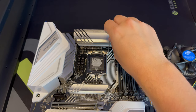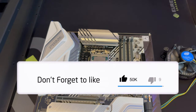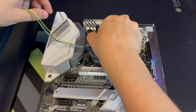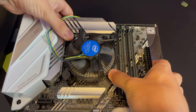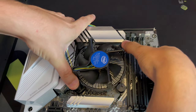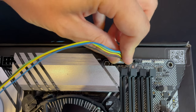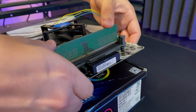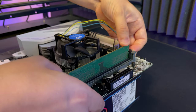Close the CPU slot, lower the pin, lock it, and the black top part will pop out — you won't need the black part. Next, install the CPU fan by aligning it with the Intel logo facing to the right. Press on the fan diagonally and lock it into the motherboard, then do the other side diagonally. Connect the CPU fan wire to where it says CPU fan on the motherboard. Then install your RAM — a couple of sticks will give you a stable rig.